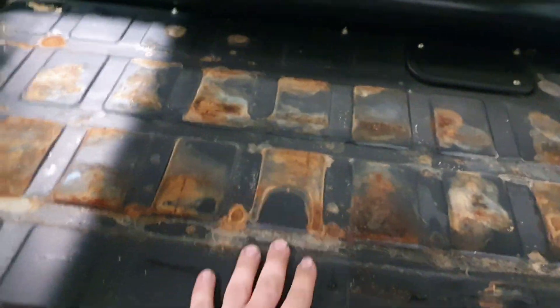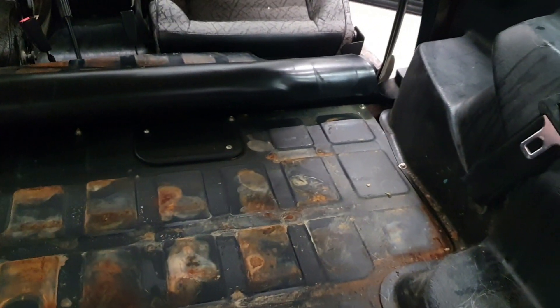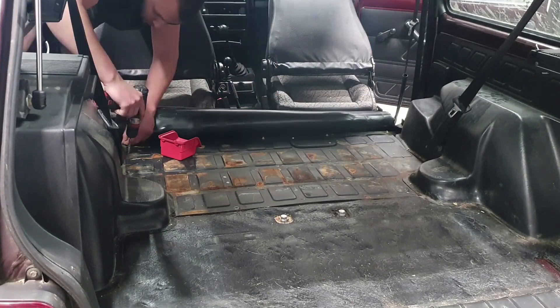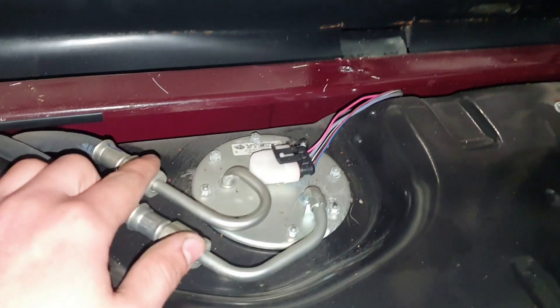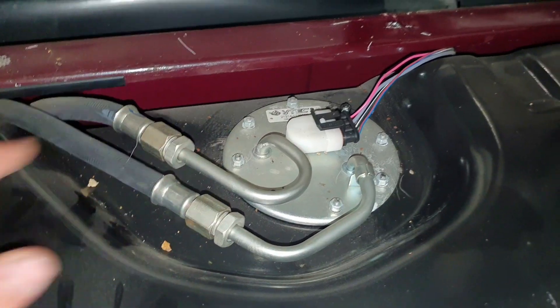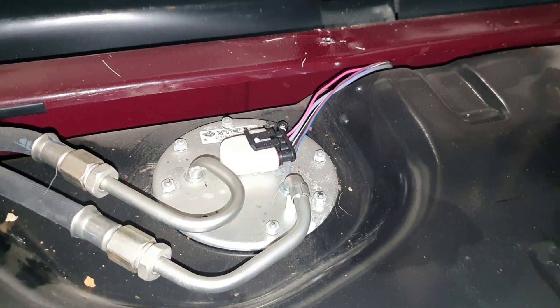Okay, now underneath here is our fuel tank. I think it's easiest to remove the rear seat first because it gets in your way. Now we need to remove all these bolts and the fuel tank will be exposed. We need to remove the two fuel lines, unplug the connectors, and then remove the bolts around it — this one is 17 millimeter. Remove that and the little ones and everything should just come out.